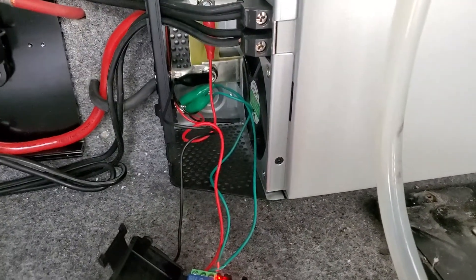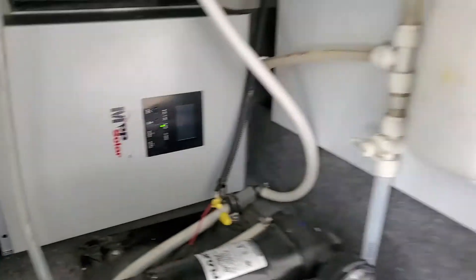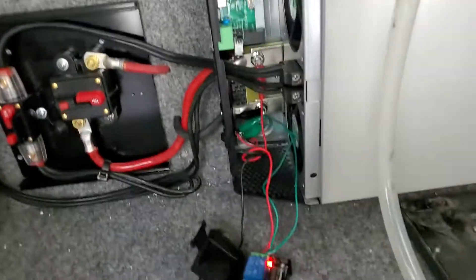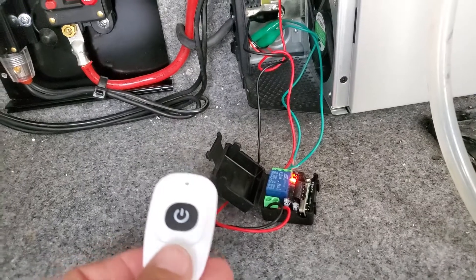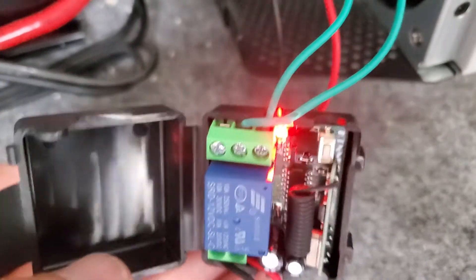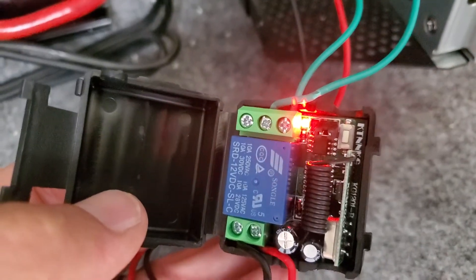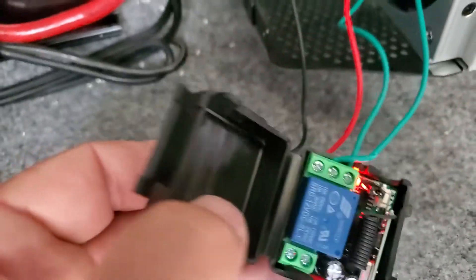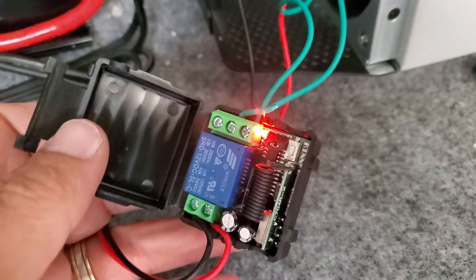Here's a nice little hack I was thinking about while lying in bed watching TV — why do I have to get up and turn the inverter off? It's under the inside of the RV. I've got two types of remote controls. This is the single-button unit. What they don't tell you in the manual is to put that little jumper closest to the switch, and you have to push that little white switch at the bottom to program the remote. All I got was the two normally open contacts on the relay.